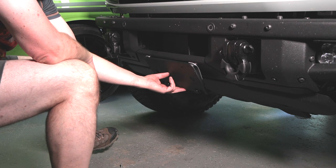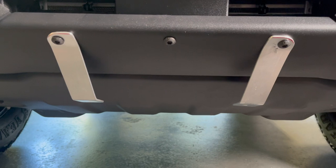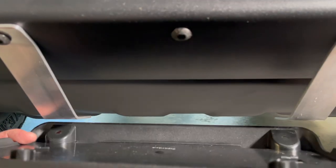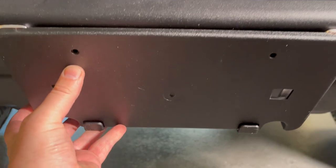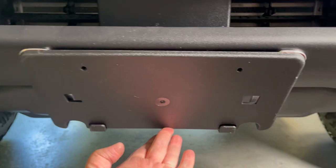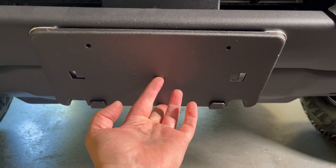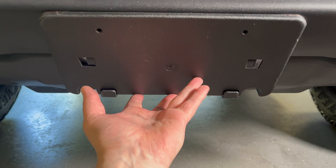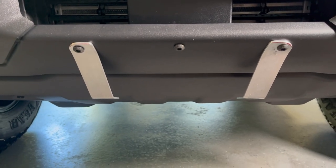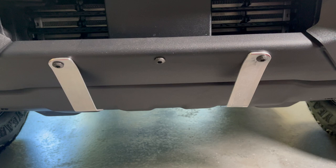Well, there's another quick project. Here's a close-up on the fab job on these little aluminum brackets to hold your front license plate, using the existing bolt mounts. We've got that bent off on the bottom — this plastic piece lines right up on those two holes there and is going to bolt in place just like that. Uses two holes already on that front license plate holder, angled in, lines up perfectly, angled out of the way kind of at the same angle as that skid plate. I really don't think that should interfere even if you're off-roading. Worst case, you can always just give it a tug and bend it down further if you need it to point more towards the front.